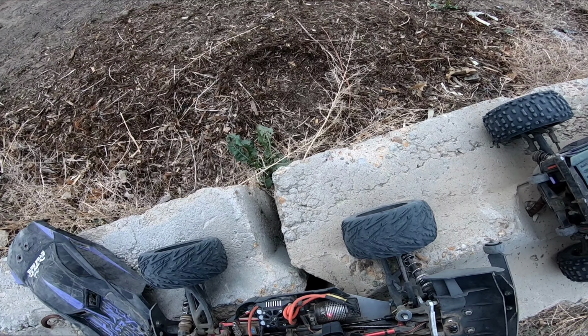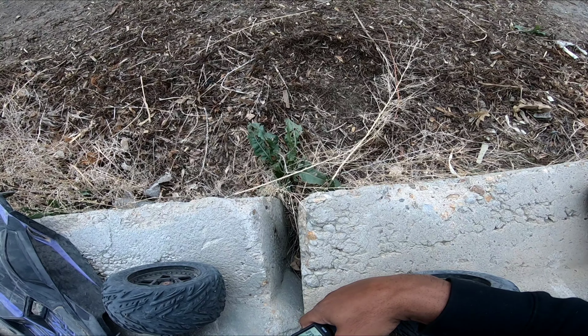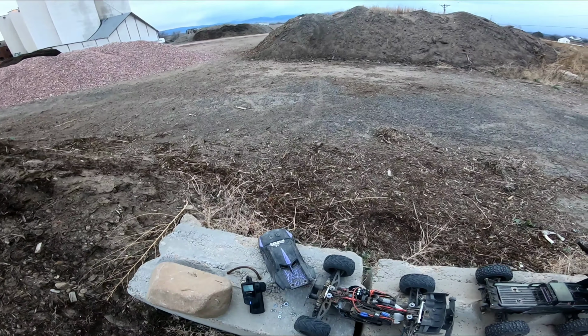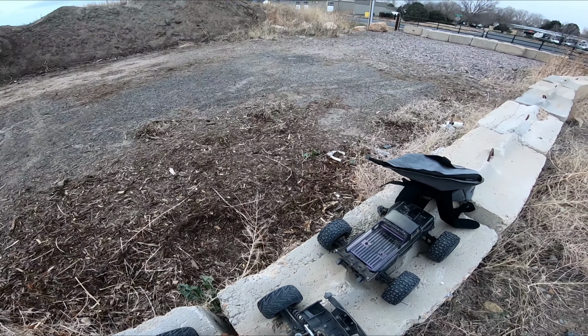Point 113, point 120, there we go. Point 120. The ESC doesn't give a shit. That's why the ESC was overheating, because the Kevlar was coming apart inside the 1650. I was like, why am I getting heat issues when I haven't at all? And I've had that geared with the 25 tooth with warm temperatures before, 60, 70, 80 degrees out. So the issues that I had the other day were because that Kevlar had come loose.